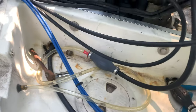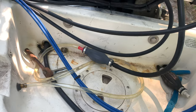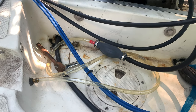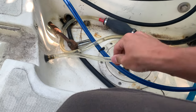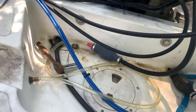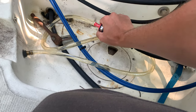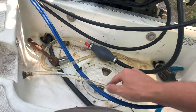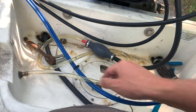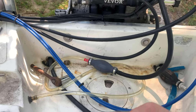While I was at it, I went to Walmart and picked up some clear tubing. There's a fuel siphoning pump kit there that includes clear tubes — you don't have to spend a lot of money. This clear tubing will tell you if you have bubbles in your line. It's normal to have a bubble or two, but if you're seeing consistent tiny little bubbles continuously, that's a problem.